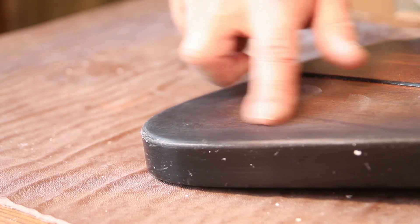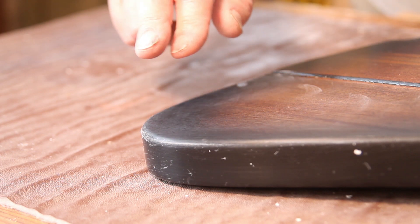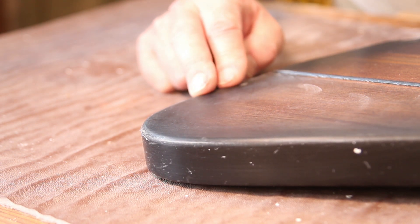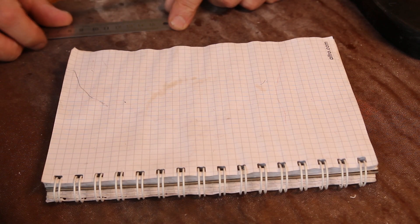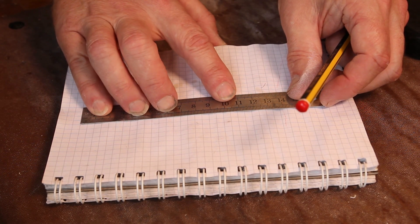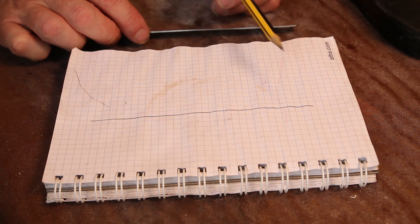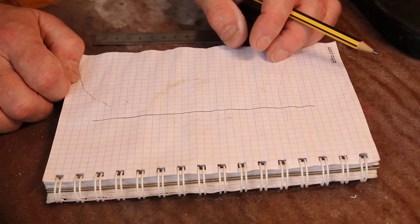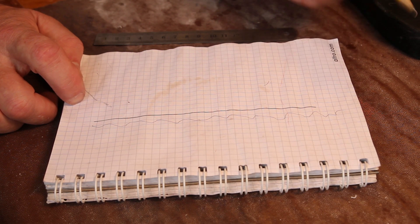There are still a few little ones in there that I can see when I catch it in the light, but I'm going to leave them and get them with the next pass with the 800 paper. I think the best way I can explain that is with a dodgy diagram, because what we're trying to achieve here is actually a two-step process. It's always referred to as polishing, but more technically you could refer to it as flatting and polishing. Flatting is simply getting a flat surface which we can then polish into the finish that we want.